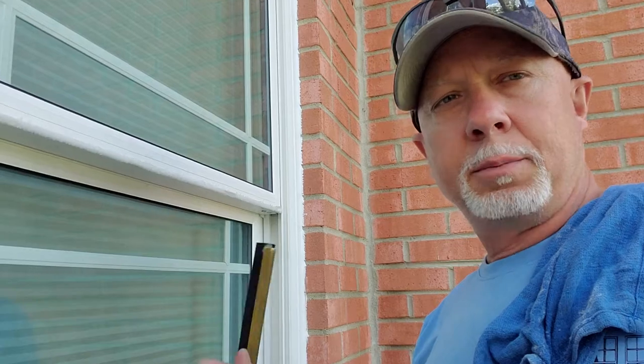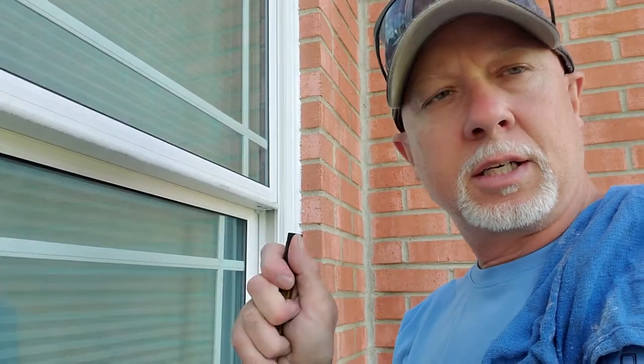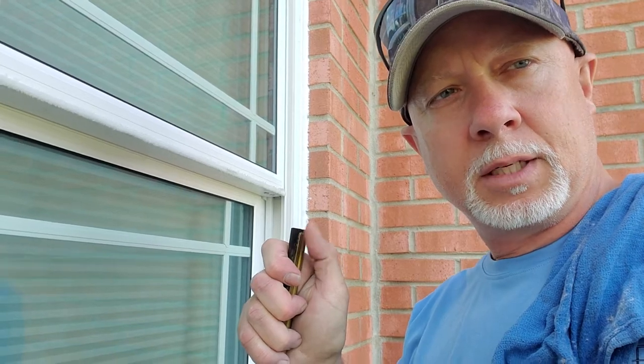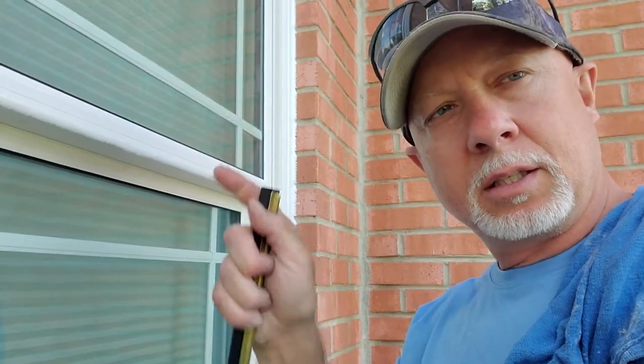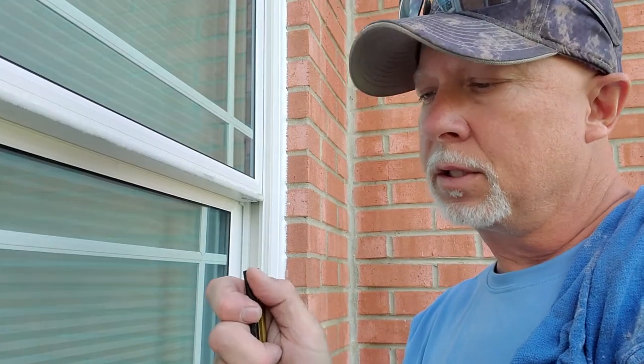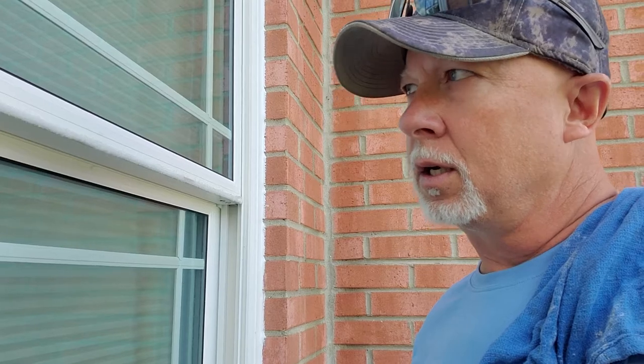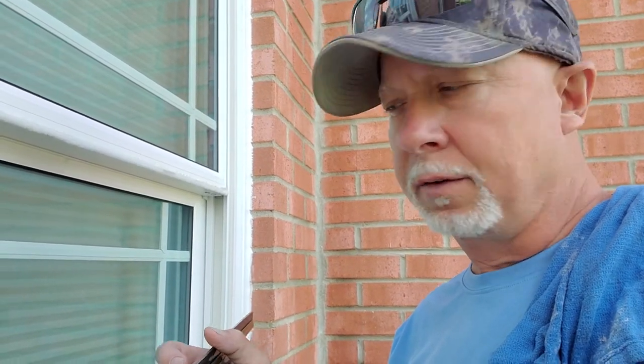So I'm going to look at the corner of my rubber and make sure it's not frayed or rounded, because if it's rounded, it's going to leave a trail of water, and if it's frayed, if it has a little splinter coming off of it, that'll trail water as well. No nicks in your rubber, because if you find there's a streak at the same exact spot, that's a good indication there is a nick in your rubber.